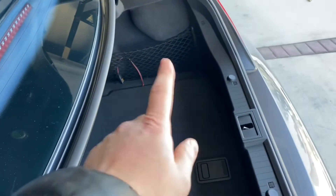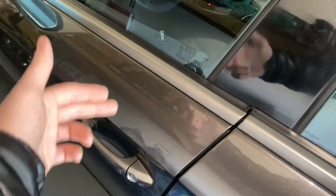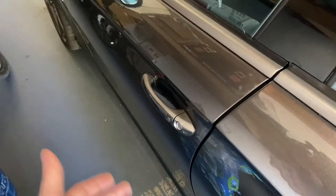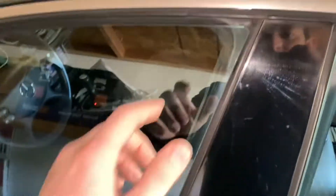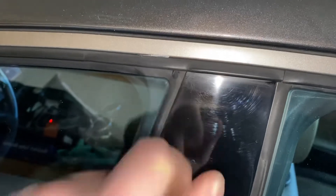What I decided to do: I didn't lock the car, I closed my door, and I decided to remove the negative side from the battery to avoid corrosion — in case water got inside, because it's constantly providing current through this door handle, and if there is water there's more chance you'll get corrosion.